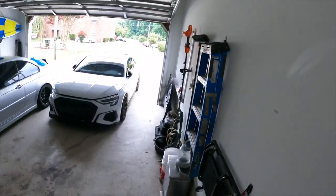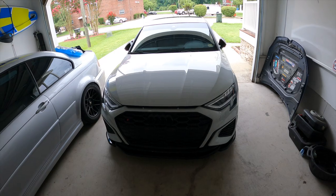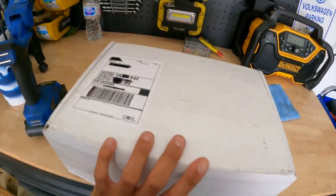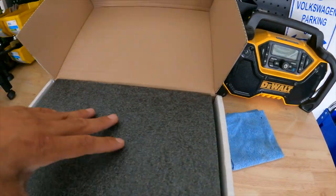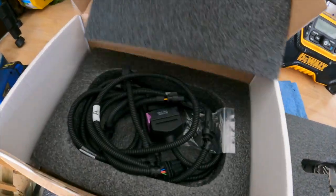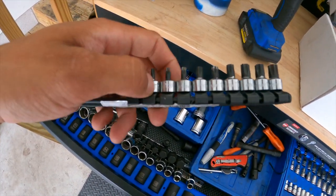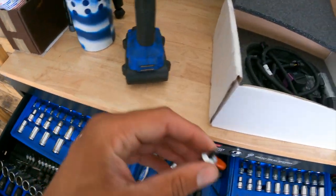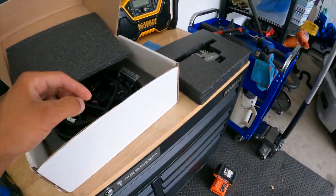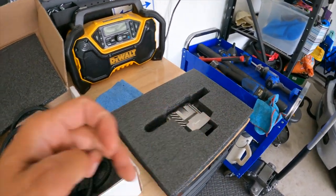We're gonna keep this video short and sweet, and so will be the same for the MK8 Golf R and the 8Y S3. You got your PCM — the only thing you need other than a set of hands. This stuff uses a T25 Torx to get the under-tray off, which is just seven screws, and then we'll disconnect three connectors, connect it into this, and you're done.